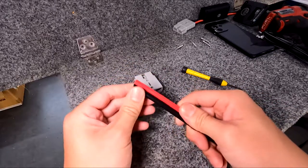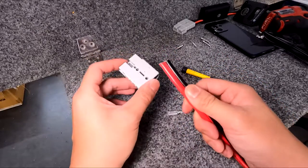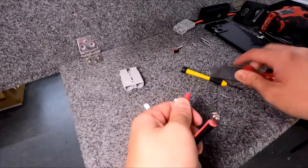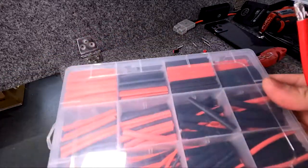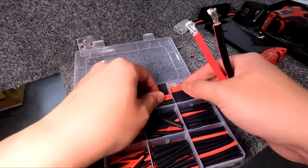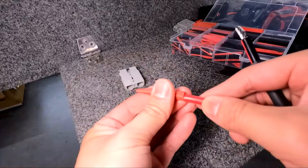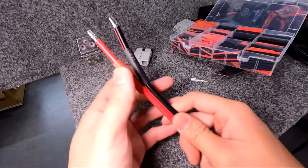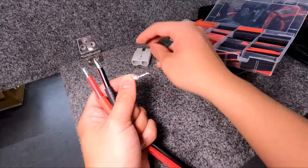I've chosen the 8 AWG cable. You can go up to 6 AWG with the 50 amp plugs but it really depends on what you need to power and what kind of amp rating you need. To prepare the cable we've got to use a knife to cut the insulation off the wire — don't forget the heat shrink. This cable is now ready to go but before we crimp it we must pay attention to the orientation to which it slides into the plug.